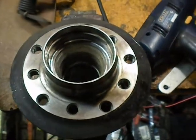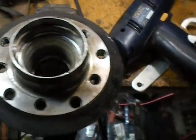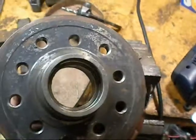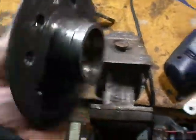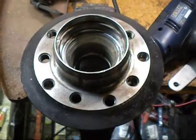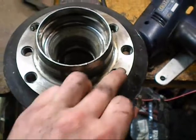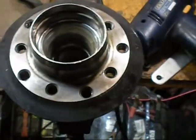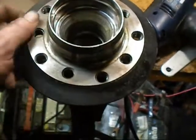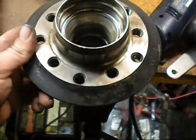I'm just doing the wheel bearings now. I've knocked those shells out, degreased the hub, and buffed all the surfaces — got all the rust off and everything, so they're all nice and ready to go. I knocked the new bearing shells in and I can put the rotors on. I hate it when people don't machine or buff the surfaces where the rotors go — it just screws everything. So you've got to make them nice and shiny.